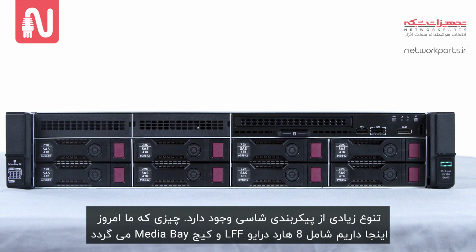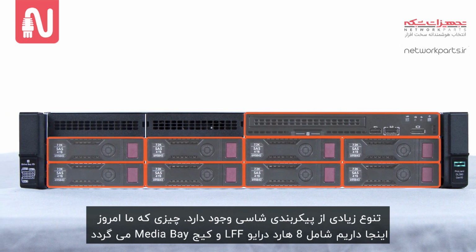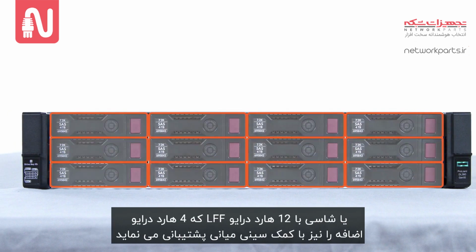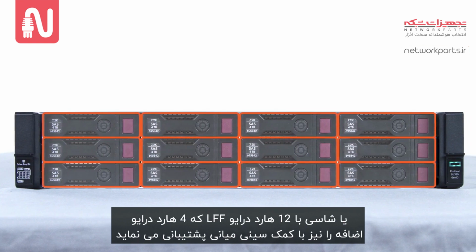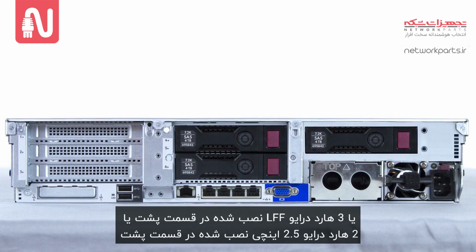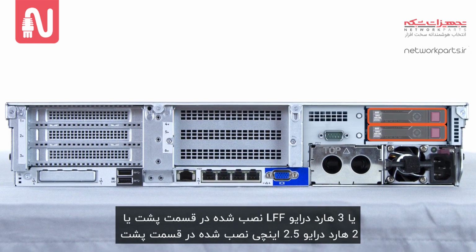There are a bunch of chassis configurations, including an 8 LFF drive chassis with universal media bay, which is what we have here today, a 12 large form-factor hard drive chassis that supports an additional 4 large form-factor drives using an optional mid-plane drive cage, or 3 large form-factor rear-mounted drives, or 2 by 2.5-inch rear-mounted drives.